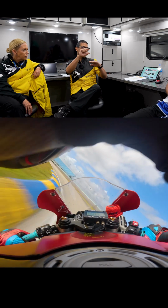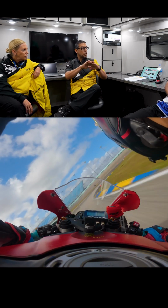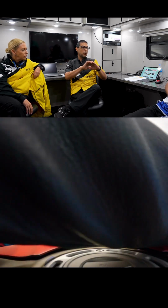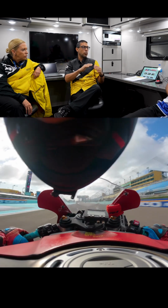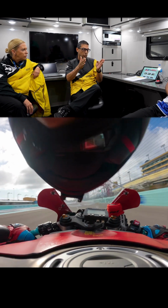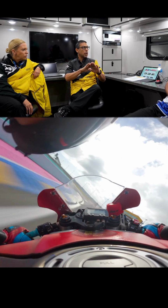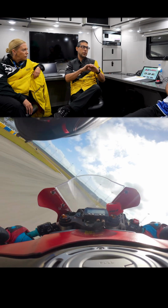So now we have a difference in temperature from the very top to the center of the tire. That's where you get that cold tearing or graining. Once that starts, it never gets better. Had you started with more pressure at the beginning, saying, look, I know it's cold, but I'll go to 28, that would have narrowed the contact patch down and probably minimized some of that cold tearing. But that's with a new tire. With a used tire, you're at a disadvantage right away.